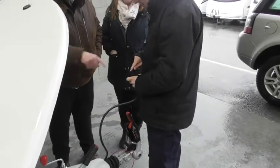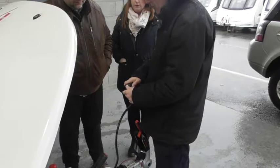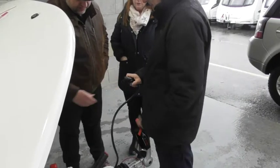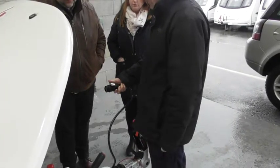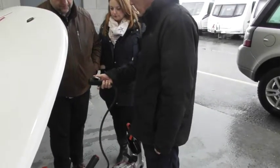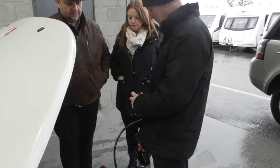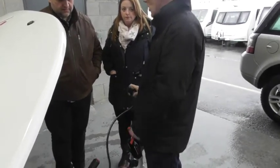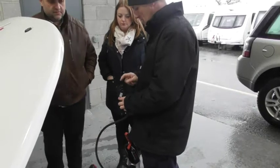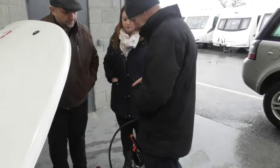When you connect to your adapter, you see it's got this little notch there, and you've got three other points here. That centre ring stays where it is — push it in, turn it, the other one turns and pulls in. When you take it out, make sure you fully turn it left before you pull it, because it misaligns that by a fraction. If that moves by a fraction you can't get it back in. There's a little tool in there which I'll show you after — that realigns it. Normally that is 90 degrees to that. When you're not using it, keep it up out of the way.